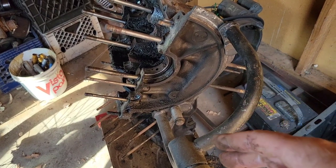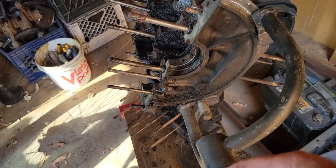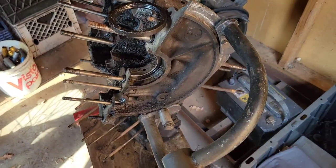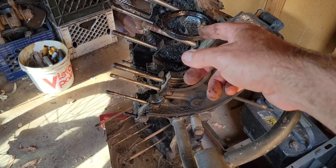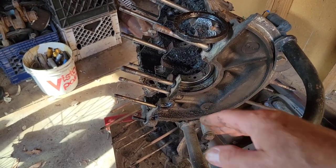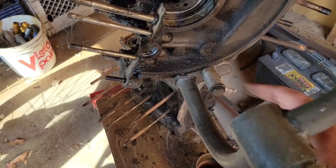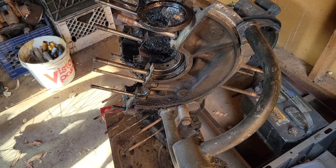On your case crack issue, you'll generally have a lot of oil coming out of the back of the engine. Maybe you've changed the seal back there — you want the German red seals, not the black ones — and you're still having leaks. A lot of times you can look really closely and look for those cracks coming from the oil gallery. They're usually somewhere in that area, and if you've got a crack in there, that's pretty much it. You're going to have to replace the case, which means you'll basically have to rebuild the whole engine.